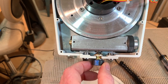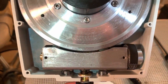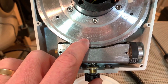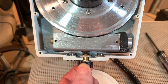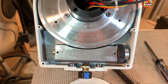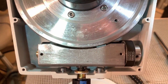Here's the knob right here. If you turn it counterclockwise or to the left, it is engaged. And if you can see in there, the worm gear here is fully engaged with the ring gear right here. iOptron's instructions say you turn it to where it's fully engaged and then back off about a quarter turn, and once you do that, it'll allow it to move freely without binding.